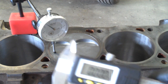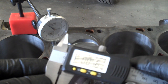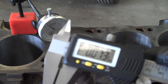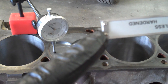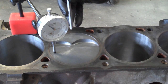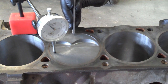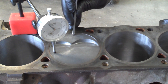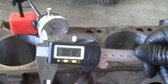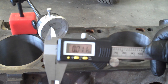First thing I'm going to do is take my caliper and zero it. Then I'm going to adjust the caliper past the reading that I know I've got — so I'm showing about 73 thousandths of an inch, and that puts the depth part of the caliper below the bottom of the caliper. Now I'm going to take my caliper and lay it where the depth gauge is on top of the piston and the body of the caliper is on the deck, and take the measurement. In this case it's showing me about 11.5 to 12 thousandths — pretty much right in line with what I had with the straight edge.